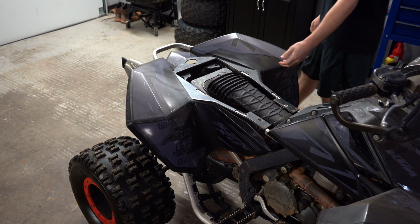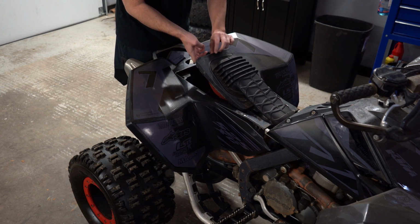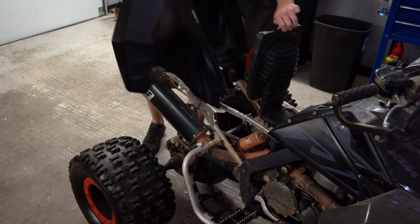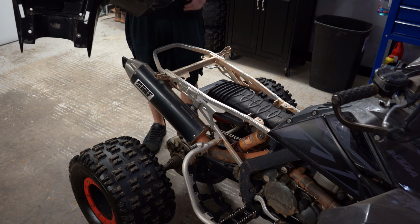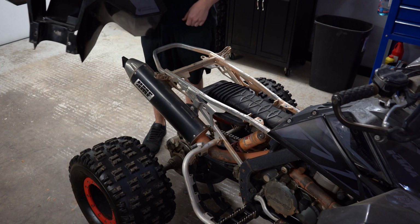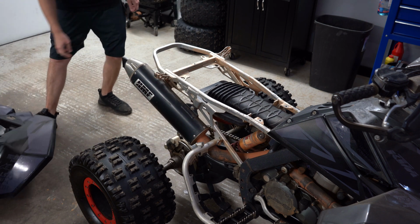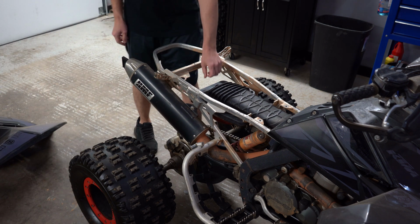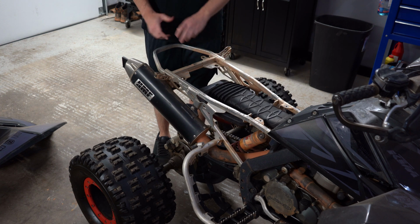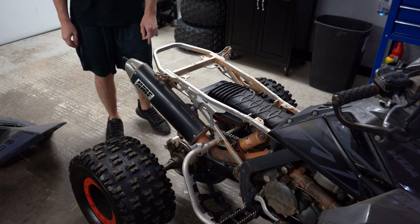Alright, so just like that, you saw the 8mm run around the rear plastic, and she is free. So we're going to bend this up, rear plastic comes right out. God, why can't every other manufacturer do that? It'd be so much easier. I wouldn't mind a clamp-on filter versus the dirt bike filter. Dirt bike filter is just a little bit more work to get back in there.